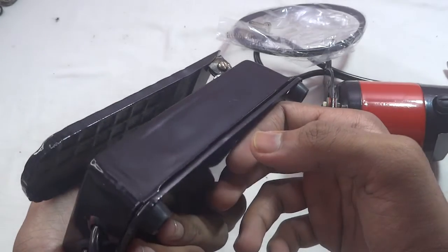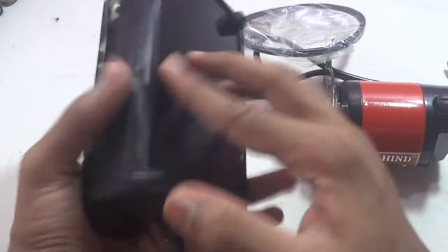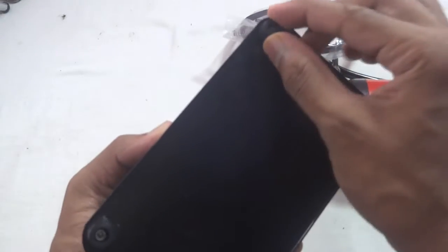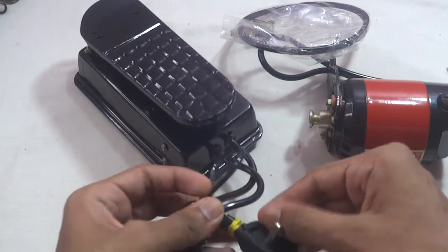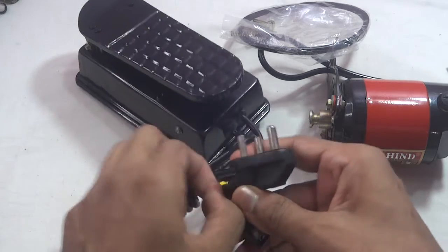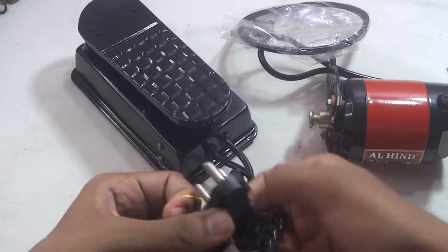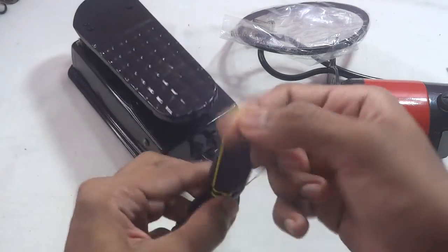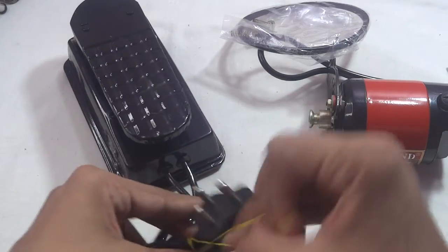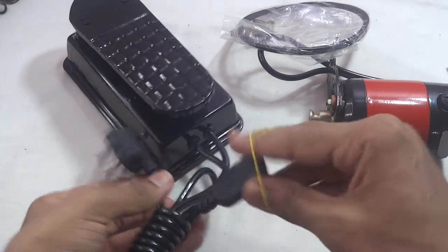But when I checked the butterfly regulator, it is not 2 speed, it is more than 2. We can control the motor speed by how hard we press, but I didn't take it apart because it is not a screw holding the case, it is like a latch. If I try opening it, I think the regulator will bend, so I didn't open it, but I tested it with a multimeter. Then I realized it is not just 2 speed, it can control more than 2.